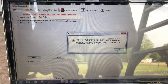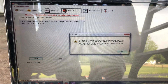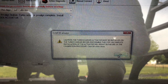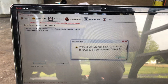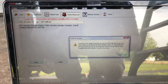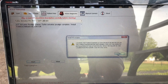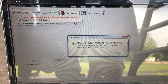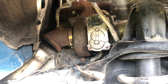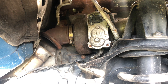The actuator just buzzed — it rotated a little bit, going from all the way open to all the way shut. Now it's prompting us to move to the next step. For this next step, you need to install the actuator on the turbo. Just remember, you want that turbo lever arm in the far left position — all the way open — and you don't want to touch your actuator from when you just did the self-calibrate feature. Now I'm going to do a cut, mount the turbo and actuator together. Got the actuator mounted to the turbo — everything's still plugged up. We made sure we didn't move the turbo from its current position, and we made sure the gear on the actuator didn't move at all.